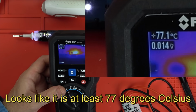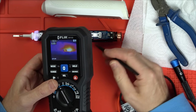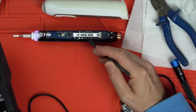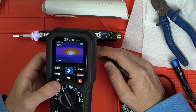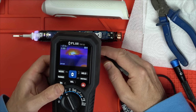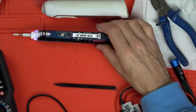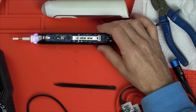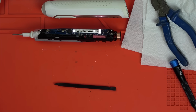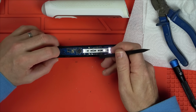Well, let's get a plastic tool and go to the middle of the heat spot. Middle of the heat spot is here, I would say. Yeah, it's that fuse. Heat spot is coming up here though as well. Right, let's press down hard on it and see what happens. Let's see if it's now going to spring and start. I'll use the plastic, then there's no danger of shorting.